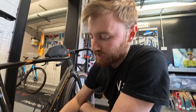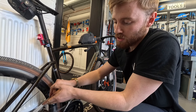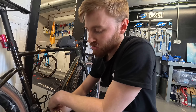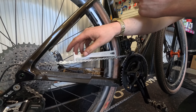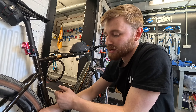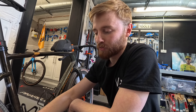They'll normally have two sides — a 0.75 and a 0.5. In a sense, 0.5 normally means 50% worn and 0.75 means 75% worn. There are ones that can tell you if it's 100% worn, but I like to change it somewhere between those. If you check it once a month and the 0.5 slots in, that's when I'm thinking about getting a new chain. If it gets to 0.75 I'll definitely change it. In my opinion you normally get roughly four chains to a cassette that way. Chains aren't cheap, but a chain is a lot cheaper than a cassette — you can be spending £200–250 on some 12-speed cassettes, whereas the chain for that exact one would be like £40–50.